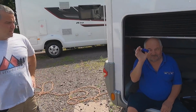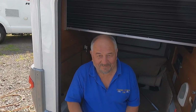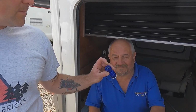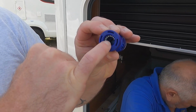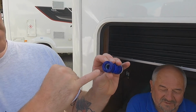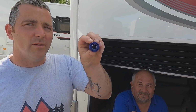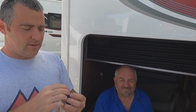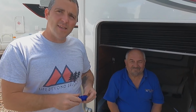And don't forget, it's a motorhome, a piece of metal bouncing around the road, so there's always things that do need doing. Everything's piped up with these push fits, so they move about. And that was only off slightly. Well, you can see where it's broken. That metal is what actually holds the pipe in. There's the other part. That metal should be the whole way around, so it's actually broken the metal, pushed it out.